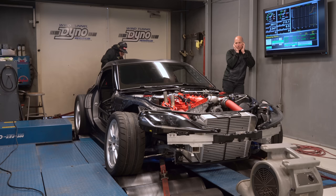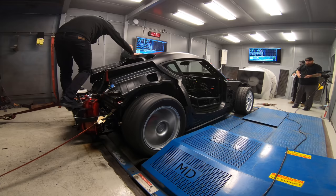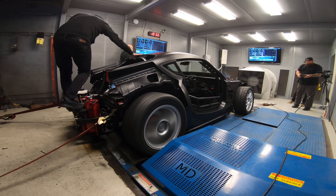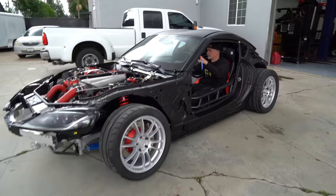If you noticed the can on the passenger side of the car with the vapor coming out of it, that's the oil breather can — it's very normal for that vapor to come out, especially at high boost. We're pretty conservative at the chassis dyno; we just boosted at 25 psi and made 750 horsepower.